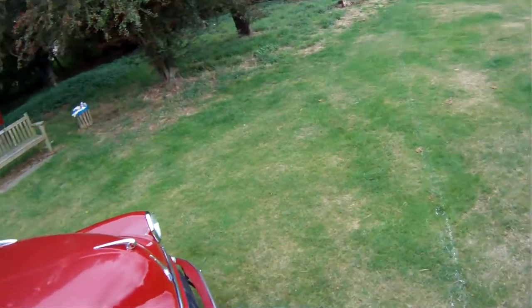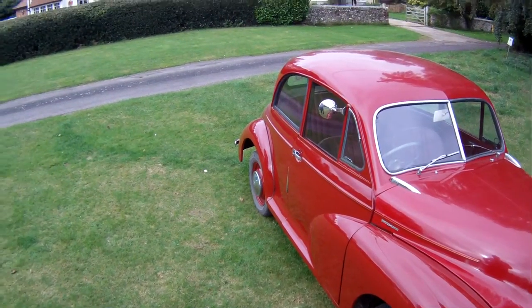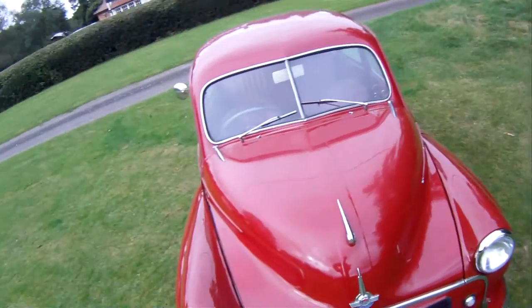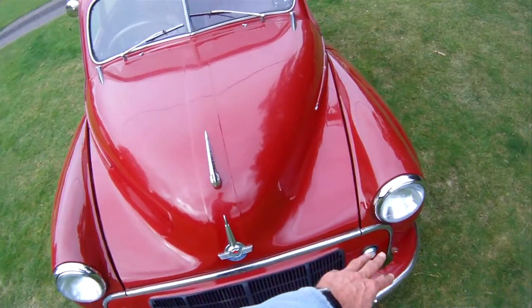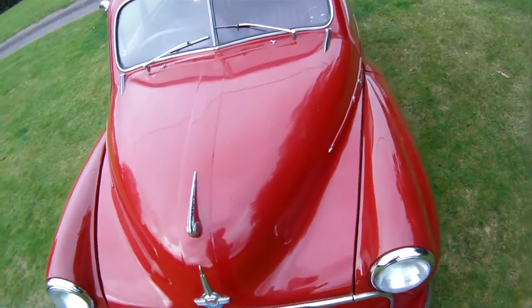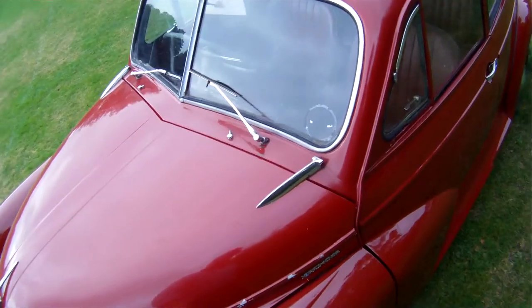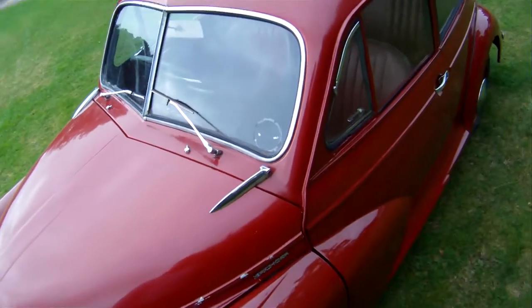Let's go around and pick out some good bits and bad bits — very little in the way of bad bits. The last owner treated it to four new heritage wings, which are very, very nice all round. It's been repainted at some point in its life — it did start life black. There's some of the Mazak and stuff around the front end that is really quite pitted. The lamp units are good, but the stuff around the grille is quite badly pitted. It's the original type cheese grater grille. Some paint loss just down here, and we've got some paint loss and electrolytic reaction just on this section of trim along here.